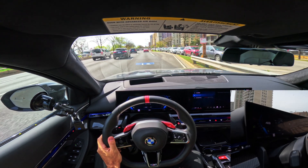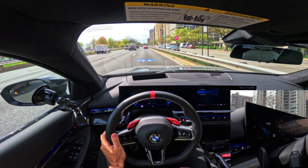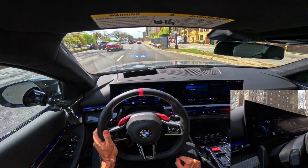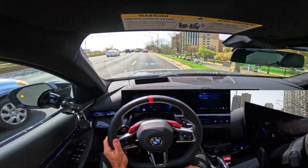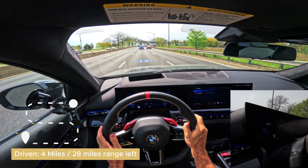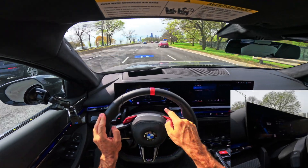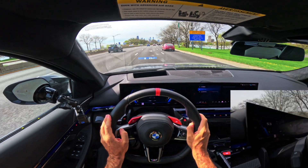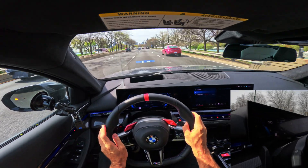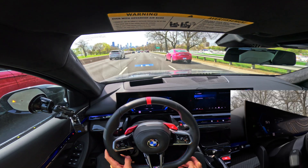Keep in mind that in electric mode the car is limited to about 90 miles per hour. But if you're on the highway trying to overtake and you kick the gas pedal, the V8 engine will kick in and that's going to mess the test. So I'm just going to go for a normal cruise, nothing crazy. So far it's within range — I went four miles and dropped about four miles as well, so it seems quite accurate. The car loves stop-and-go traffic because you can lift off the gas pedal and regenerative braking puts electrons back into the battery, giving you a little more range. On an open road at higher speeds, the battery pack depletes faster.